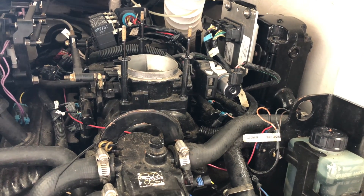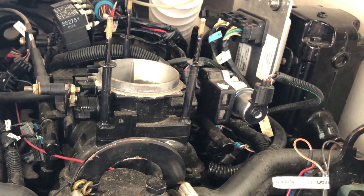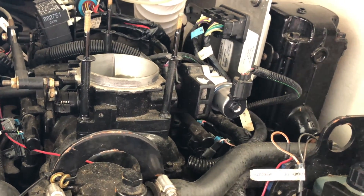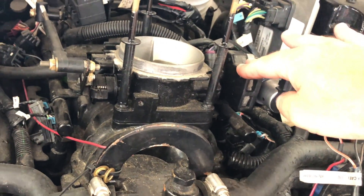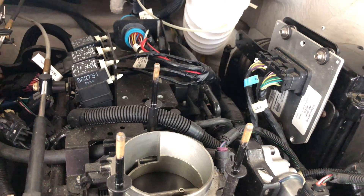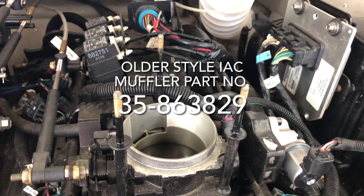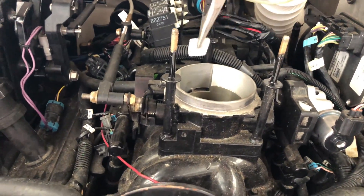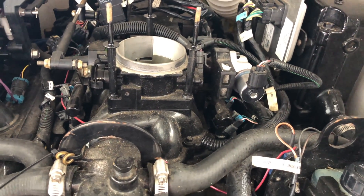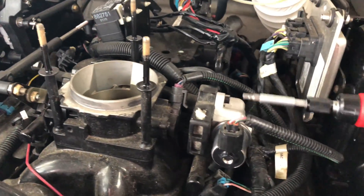There's a filter on this valve. If you have the newer model like mine, go ahead and change the filter at the same time — that filter part number is 35-8M2001030. If you have the older model that does not have this assembly, your filter — also called an IAC muffler — is located right down inside the housing, and that part number is 35-863829. You would replace it by sticking it right down in there. I actually purchased both parts in error since I wasn't sure which model I had, so hopefully this saves you from making the same extra purchases.